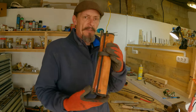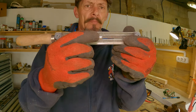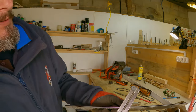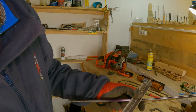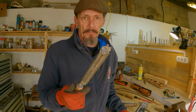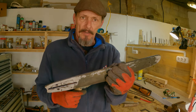Now I'm happy the bar is healthier — I'm going to show you how to sharpen the chain. You can buy kits from Stihl, Husqvarna, or anybody else. This is a 0.325 pitch file — that's what it says on the file. The lines on it show what angle you should hold the file: this line here is parallel to the bar of the chainsaw so you know you've got the correct angle. When you come to do the other side you use the other line. I often take one of these with me when I'm out working to quickly put a bit more edge back on the chain.